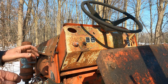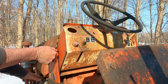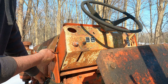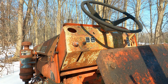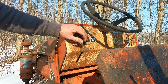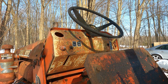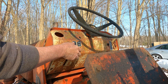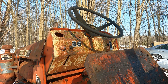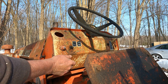Okay, we have a new switch on there. We're gonna try take two — see if she'll start. Oh, that tells me it's gonna go but the timing's off. Let me move it a little bit one way or the other. Listen to this — whoa, I know that timing's off. I'm gonna move it. Let me try to move the distributor.